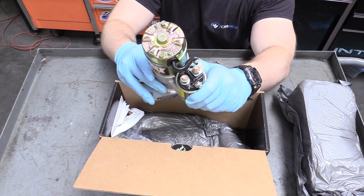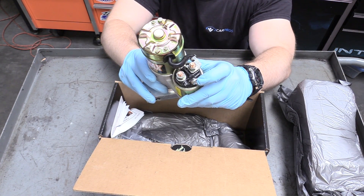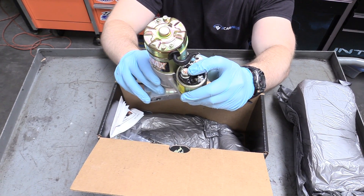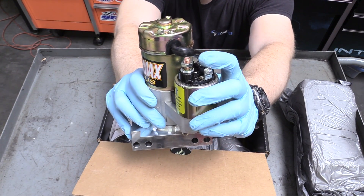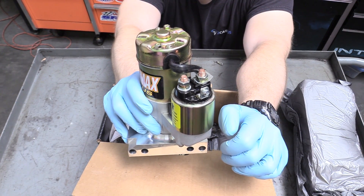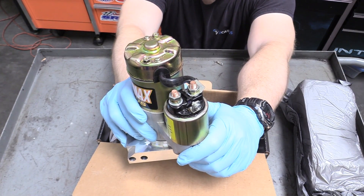So I'm going to go over the back of this while it's outside of the car. This little teeny tiny bolt here — that's the trigger from the ignition, so when you hit the key, this is what activates that. Now where it gets power is this nut and stud, which is going to come from the 12 volt positive of your battery. It's actually going to be the whole junction power for the entire car right there for this situation, and more modern cars that's not really the case, but this is old school.